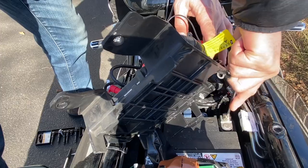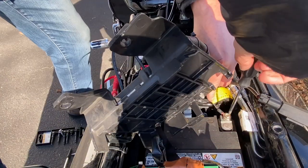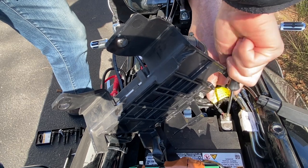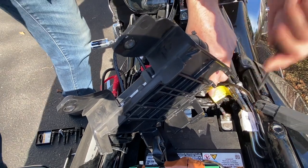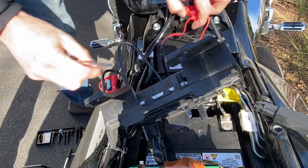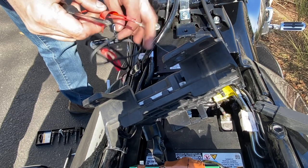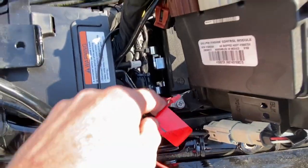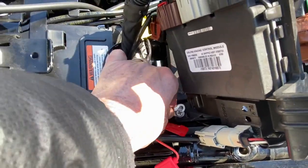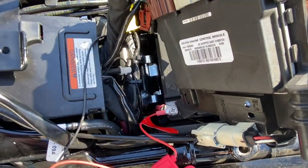Simple harness. In my case I'm only putting the gloves on it — the gloves are 2.2 amps, so I put in a 3-amp fuse. Now connecting the negative to the terminal — nice and tight — then the positive, red cable. Connect it right there and tighten it.